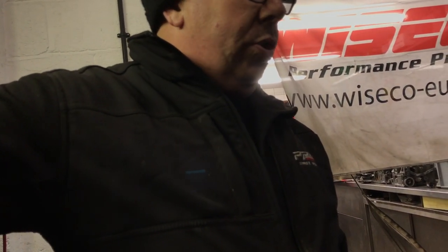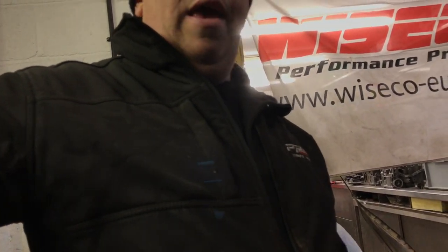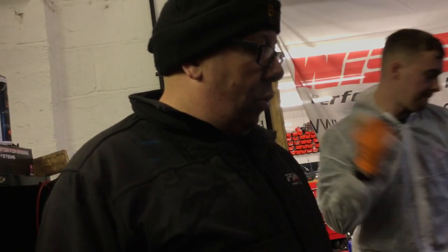Spark plugs? Spark plugs, yeah. We tend to say once a year. Once a year, okay. Mileage dependent. If you're only doing 6,000 in a year, then I'd probably leave it a couple of years. Oh, okay. Yeah, that type of thing, really.